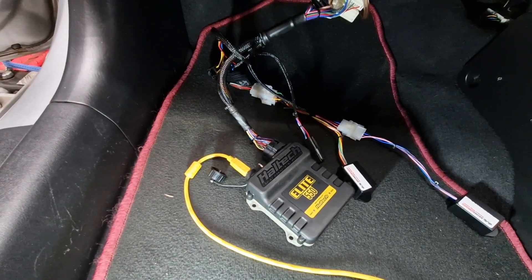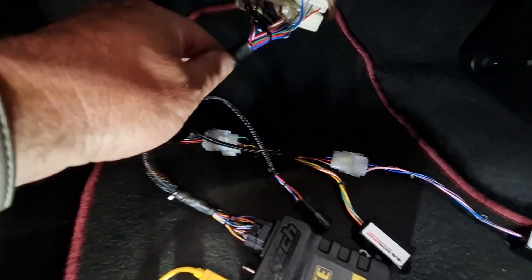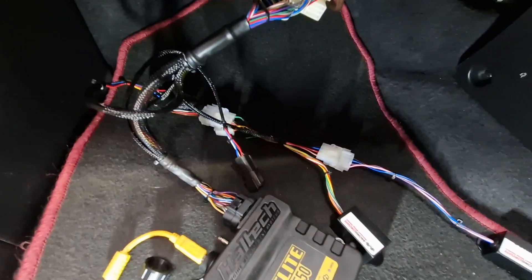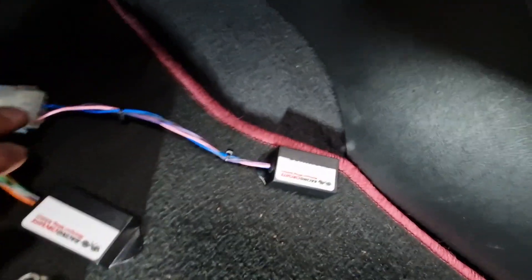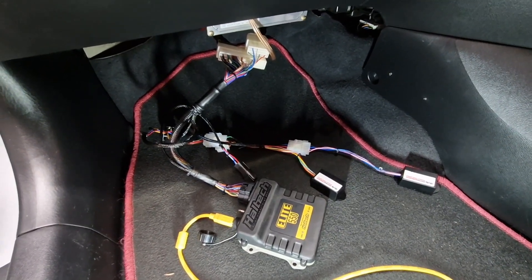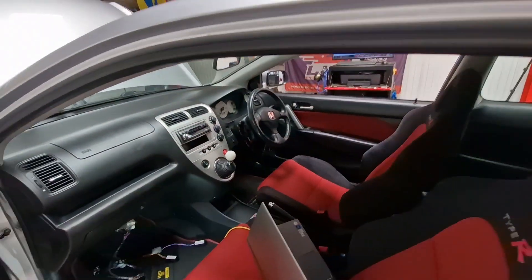I can show you the breakdown of the component parts here. This is the full kit with all the options. We've got the Elite 550, an onboard 4-bar MAP sensor, a conversion harness we've had made up, relays that control our main relay and VTEC solenoid, a CAN output that goes into ancillaries such as the IC7 dash, wide bands, CAN pads, and other bits. We've also got two modules — one is the reverse lockout and the other is our coolant temperature for the multiplex to enable the dash to work on the car. We've got cars up and running and mapped on the systems with base maps now for both a standard car and a modified car. We'd normally send out the kits with a 4,000 RPM limiter safe map to enable you to get the car started and running, and then you can get it to your chosen mapper and go from there.